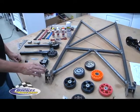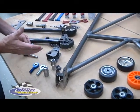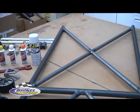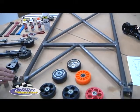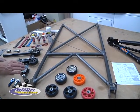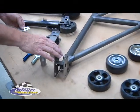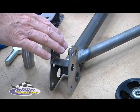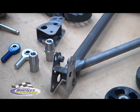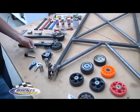The 4130 wheelie bars with this caster box, you can buy them in a welded form that we can do by us getting the length, and we can help you, or Jerry can make a recommendation based off the wheelbase and some information he'll get from you on your car. The length of the bar, the lower mainframe can be made up on the centers that you need it to be on, and the upper bar generally is fabricated on one end where it would hook to the rod end to the caster box, and then we leave the bar long with a tube adapter supplied to you with the rod end for where you would attach it to your rear axle housing. Not knowing the height and or the location of the tabs on the rear axle housing kind of prohibits us to build them complete for you.